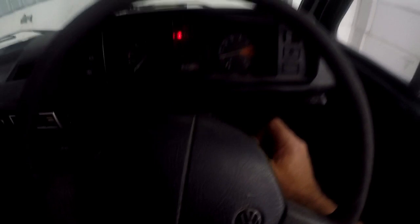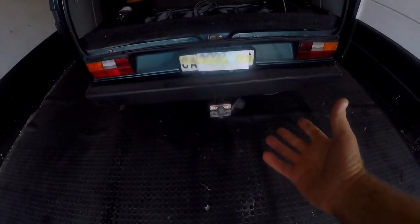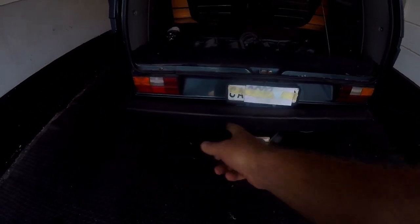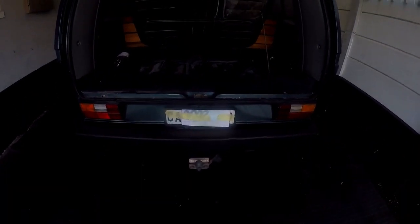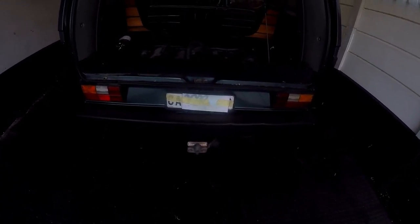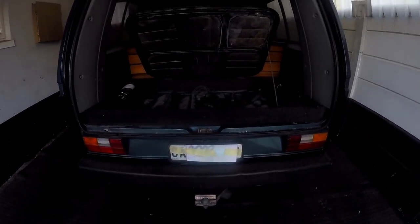Let's get back to the job. At the bottom of this vehicle there are two plastic plates which interlock with each other and come off with size 10 nuts or bolts. If you're going to be doing a service, you'll find them down there. It's very simple to take out, so I'm going to get those two plates off to get started with the service.